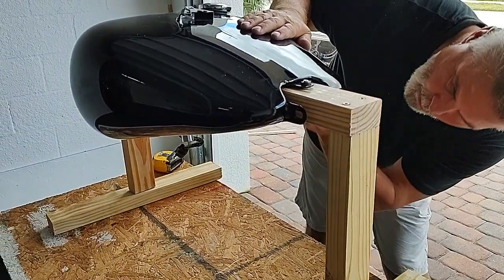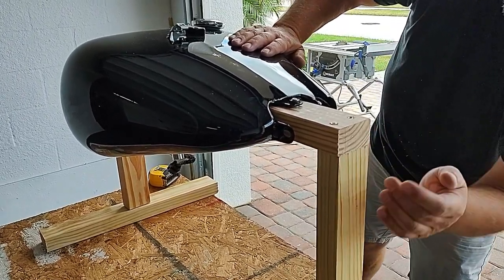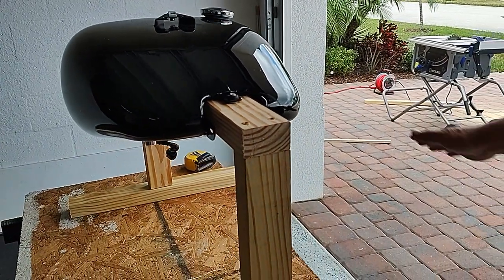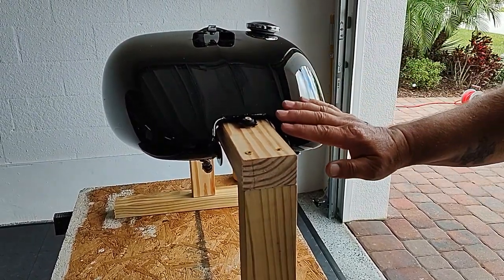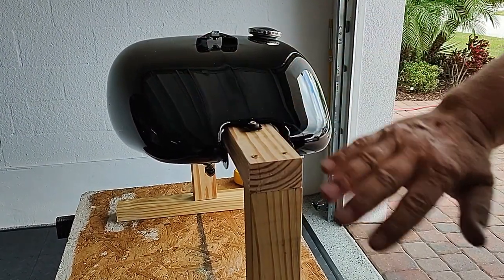We're not so concerned about the underneath. I'm not even going to paint the underneath. I'm going to go down to probably just under where you wouldn't be able to see it anymore. Now, are you going to prime these tins or not? I don't think you have to, as long as I don't get down to bare metal. If I get down to bare metal, I'm going to have to prime it, but I'm not going to get down to bare metal. I mostly want to just get the factory clear coat off, and into the black a little bit.